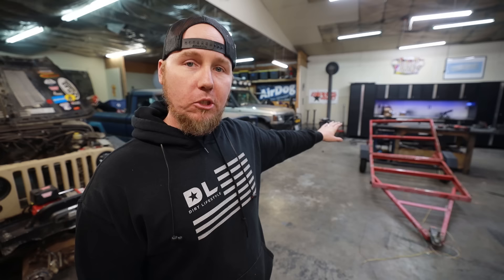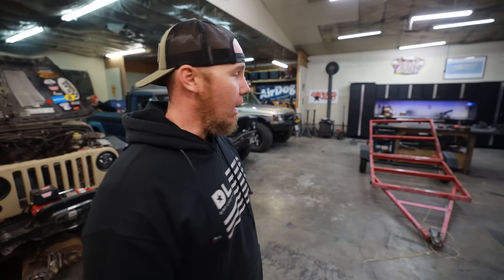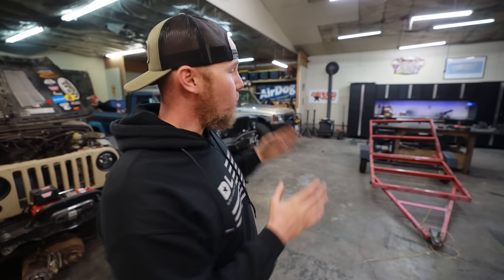I just want this to be as legal as possible and easy to go renew the license. So what we're going to do is use this as a utility trailer. I do know for a fact that with a utility trailer, you can build sides for them in Washington state, and that's completely legal. So we're going to weld it in a way that's legal, get rid of all these flimsy joints, build walls on top of it — but there's still going to be the original structure underneath, the original bones. That way, as soon as I'm done, all I have to do is re-register it in my name because I have a clean title, and I have a perfectly legal trailer. That's the long way around, but that is why we're reusing Harbor Freight parts instead of building from scratch.